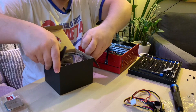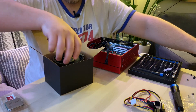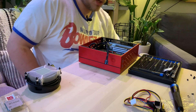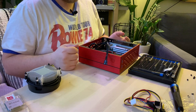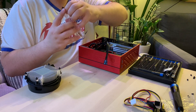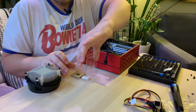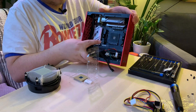I could have used the 3400G APU, but I realized that the BIOS on this motherboard hasn't been updated yet, so it would have resulted in having to flash a new BIOS, and I just really didn't want to do that for a 7% performance increase. So we're going to put the CPU in here. You just want to lift up this little cam arm in the case and lever it this way.